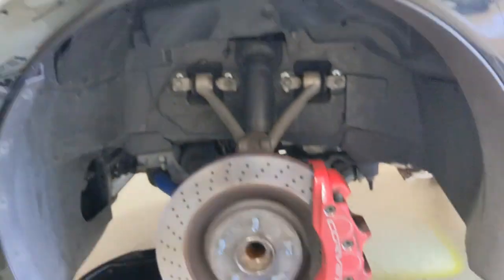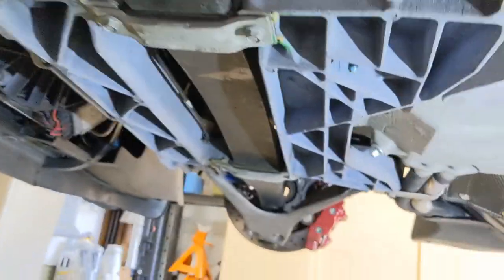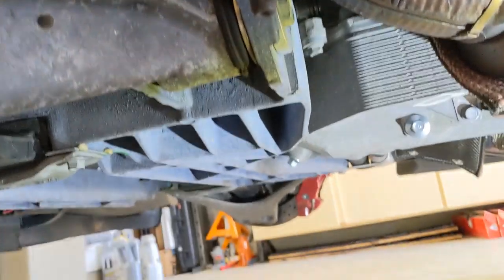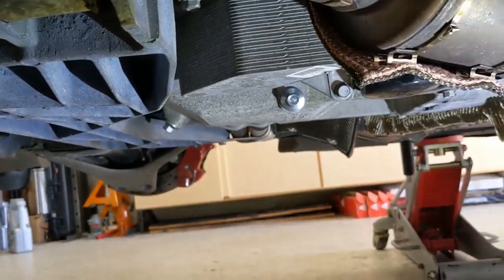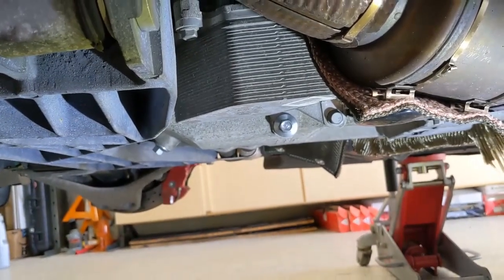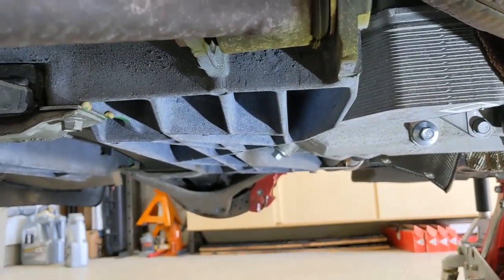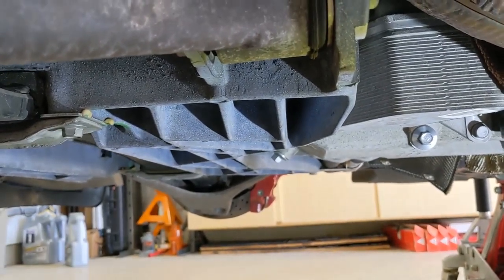The drains on this LS7 motor — like I said, there are two of them. Right in the middle of your screen, that shiny drain plug, and one other one there in the middle of your screen. So you have to drain both of those.